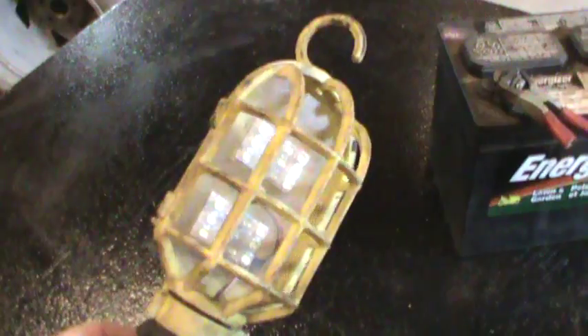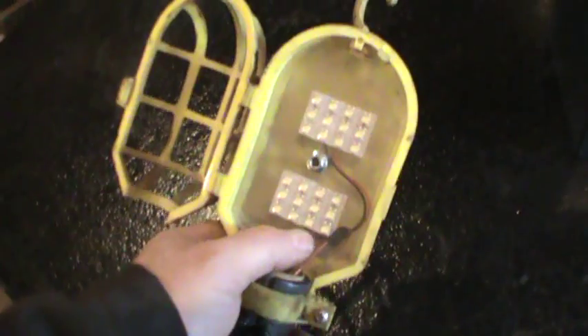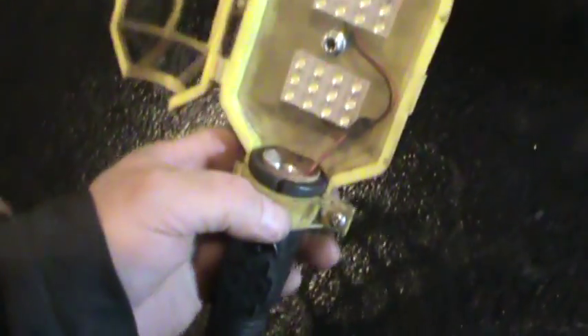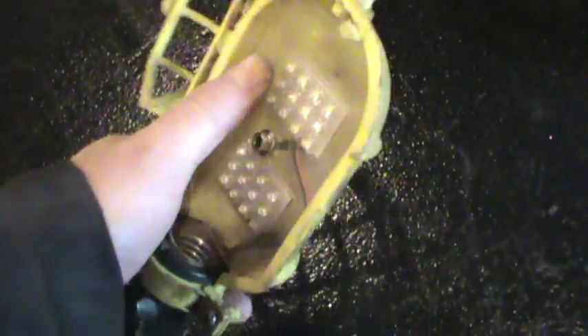So what I did was I modified this light. I've got two light strips that I actually bought at Walmart — two sets of these lights used for replacement lights inside your car. You can replace them with these LED lights. I simply soldered them into the connection down there. I have a plastic backer in behind here, and you can see there's a second plastic piece.